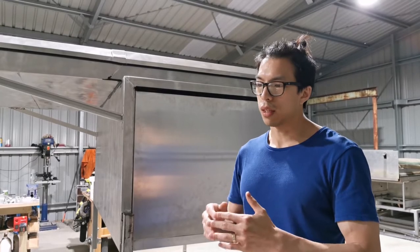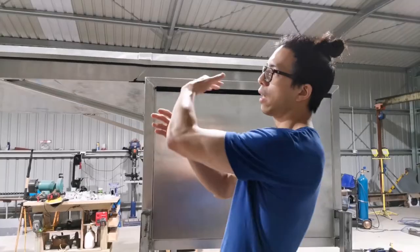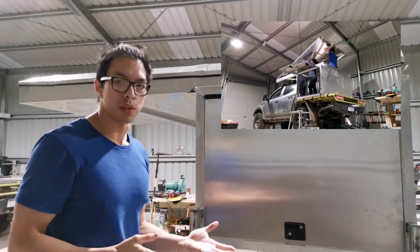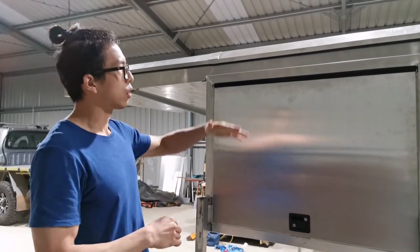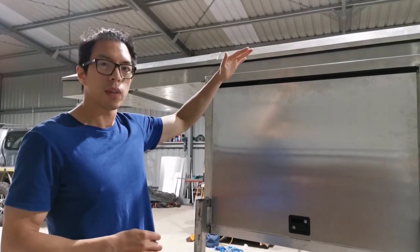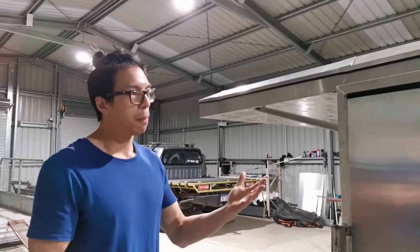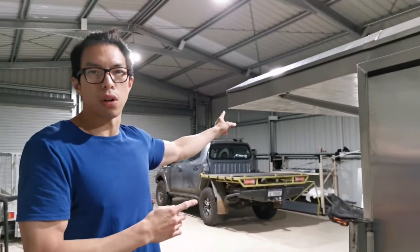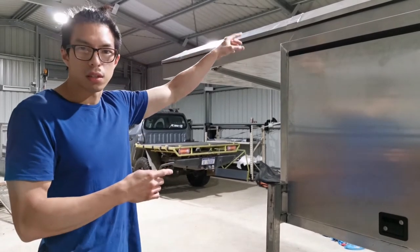In my application we're trying to lift the canopy roof in a way that we find both useful and spacious. Originally the roof pops up so the rear end has most space — the idea being that when you walk up into the canopy you could stand up, and I'm about 1.8 meters tall. However, when I entered the sleeping compartment it was very claustrophobic, so it didn't quite work. Also, that side wasn't really a suitable hinge — the hinge needs to be very strong because it becomes a very important attachment point together with the two gas struts on the side.